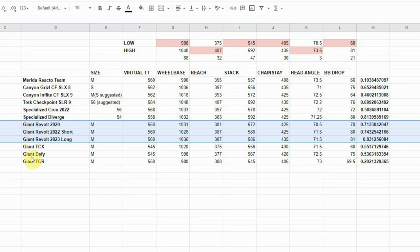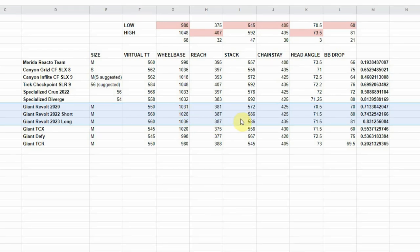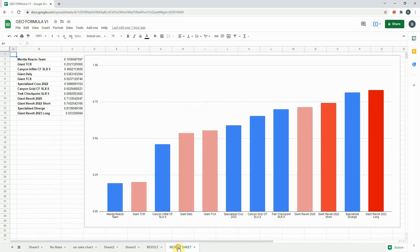I've put in quite a few Giants to see how they all stack up. I'm just over 5'10" with a 32-inch inside leg, and these are the frame sizes manufacturers suggested for each bike. It's interesting to note the differences in virtual top tube lengths — the new Revolt has a longer top tube than the old one. The wheelbase falls either side of the old one because you can have a long and short version, with slightly longer reach, slightly taller stack, same chainstays in the short version, slightly steeper head angle, and the bottom bracket has been dropped quite a lot.